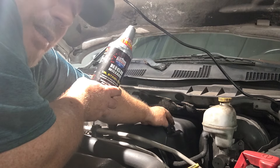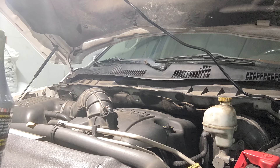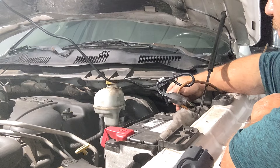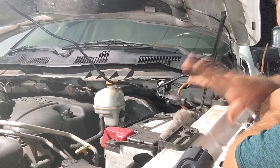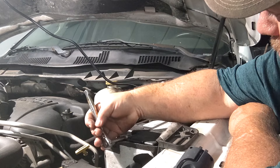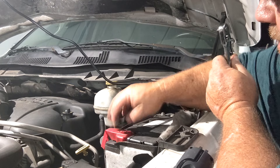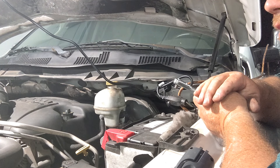I really ought to consider turning this into a lifestyle weight loss channel. Belly's in the way. I haven't had any dinner yet, going to figure that out too. Sometimes on these Chrysler vehicles, these clamp-style battery terminals have a way of working themselves loose. When that happens you'll have your headlights flashing on and off at night or the gauges will do weird things. I replaced these battery terminals with factory-style ones and haven't had a problem since. You've got to have good connections or you're going to have electrical problems.